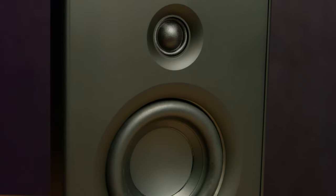You can remove the magnetic grille if you want to. The woofer is a four-inch driver and there's a one-inch silk dome tweeter with a crossover at 3K. These are made from stiff recycled plastic to minimize resonance and coloration, giving you a really good sound. Another cool thing about the Unit 4 is its future-proof design with replaceable components — the battery, driver units, and wireless electronics are all replaceable. It has a glue-free design for easy disassembly, and all the main components are made from 100% recycled plastic.